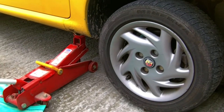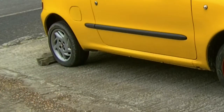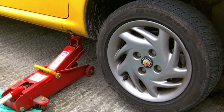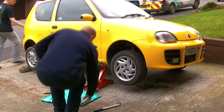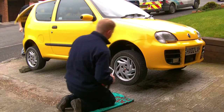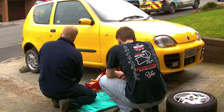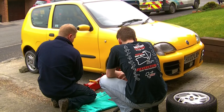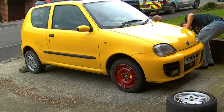A process that begins with jacking the car up so we can get the wheels off. On our sloped driveway, it's also important that we chock the rear wheels, and unfortunately, since it's not possible to get a jack underneath it on a slope, we're going to have to put a spare wheel on so that we can stand it back down on the driveway. We begin with me getting the spare wheel out of the boot to replace one of the front wheels with, and my dad getting the driver's side front wheel off. With the spare on the front driver's side, we then move around to the passenger's side, and using an extending tyre iron, I use all my strength to undo the nuts.